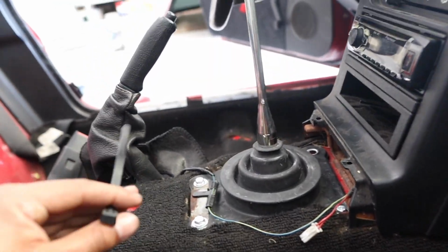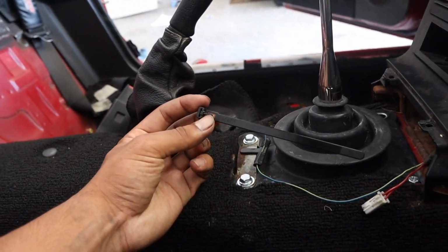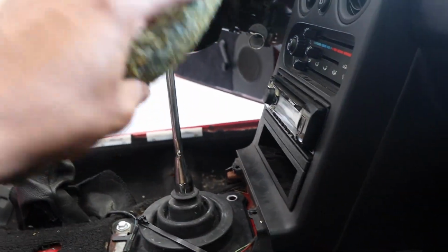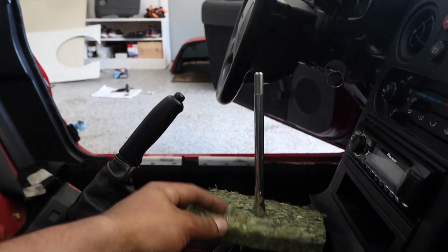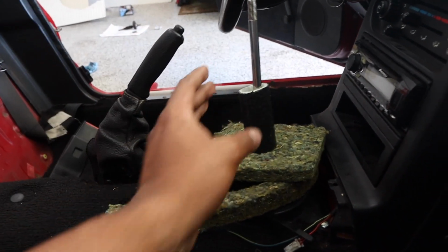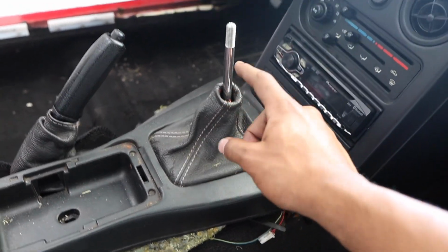So the next step from here, if this was a permanent solution for you, I have a lot to put back in my interior. You take this reusable zip tie and put it around here where the white collar was on my old one. From there, just for demonstrational purposes, you would put the heat shielding on like so and kind of have it tucked in like this. Then you put the shift boot support tube just right on top of this, and it would look something like this. That tube is there so the shift boot sits a little bit higher.